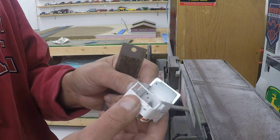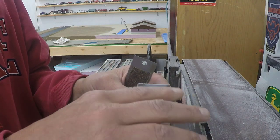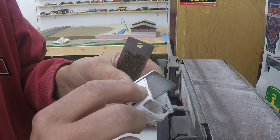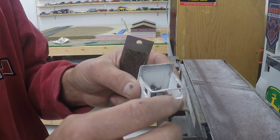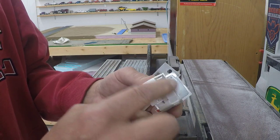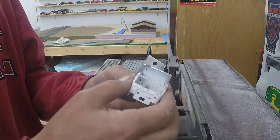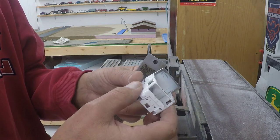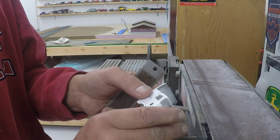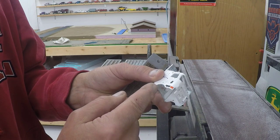So the next step now, and you'll notice that I went ahead and sanded off the top and smoothed up these edges. I did have one spot here where it gouged a little bit with my saw blade. Not a problem, we can fill that in with body filler. This part up here where the visor would normally be is really, really thin, but we're gonna cover it with a visor anyway, so I'm not concerned about that. As I said, next step is we're gonna go to paint stripper and get all the paint off of this, and then we'll begin moving the axle forward and the bodywork back here.